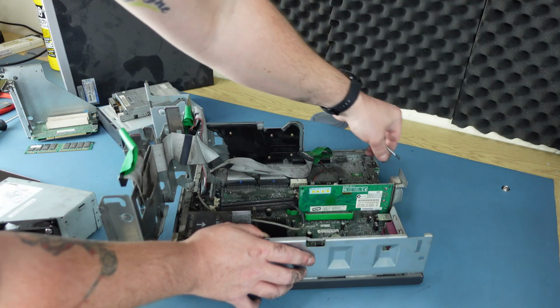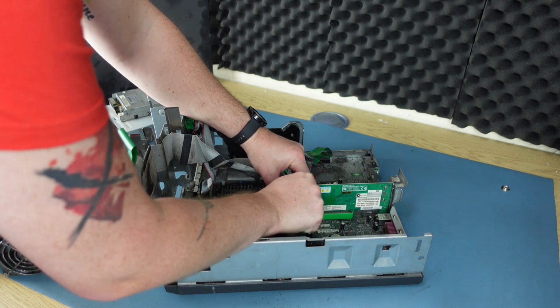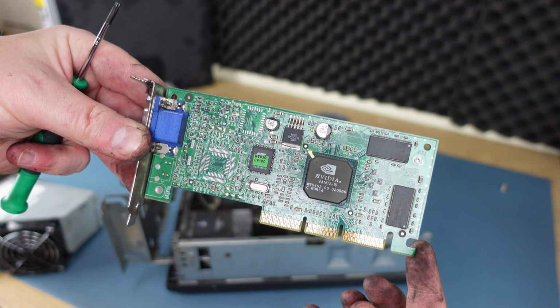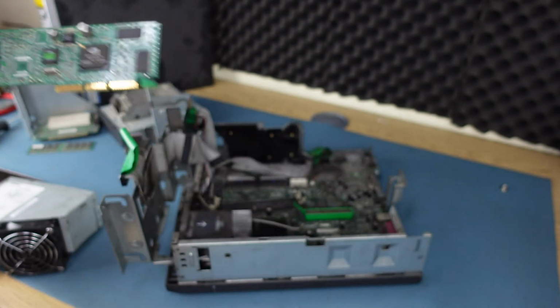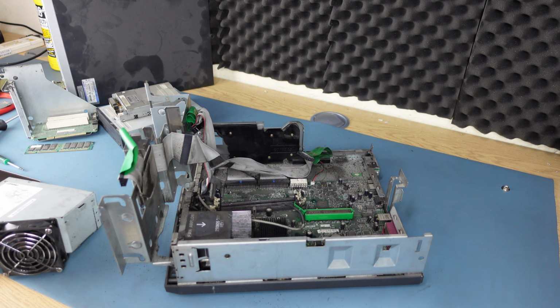The graphics card in this machine is actually a discrete card, which is a little weird for a business machine. This half-height card connects to an AGP slot on the motherboard, and it's an NVIDIA Vanta 16, which Google tells me is basically a TNT2 based card for lower powered machines. It won't be much good for gaming, but at least it can do some basic Direct3D hardware rendering.